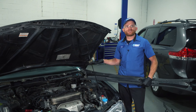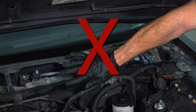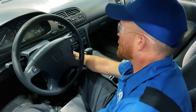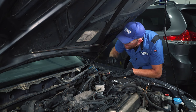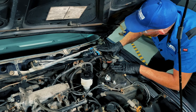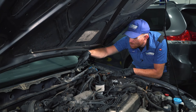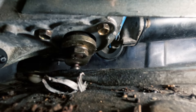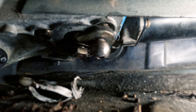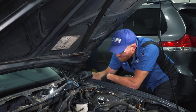The next thing we're going to do is retest the functionality while we can visually see this. An important note: never stick your hands or anything else inside this area while you're powering up the motor. I can hear that the motor's functioning as it should — I can even feel it. This whole thing's moving but nothing's actually pivoting the way that it should. If properly connected, the arms inside should be moving and spinning each of the areas attached to your wiper arms. Directly underneath, there's a small adapter with a ball that's supposed to attach to the rods, but on this one it's really not attached at all.